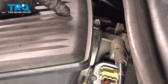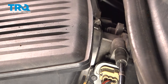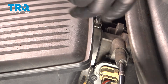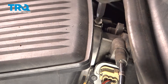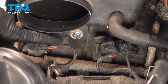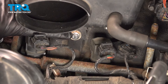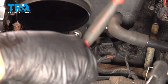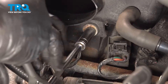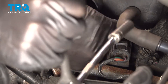On the back side of our air box, between the throttle body and the box, there's going to be a clamp or hose clamp — loosen that. Now on both sides of the air box, there's a bolt underneath securing it. Use your 10-millimeter socket and ratchet to loosen and remove this, then repeat for the other side.